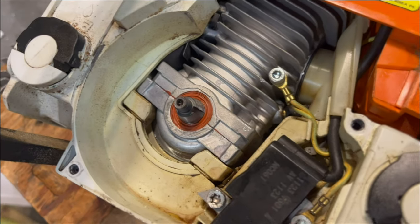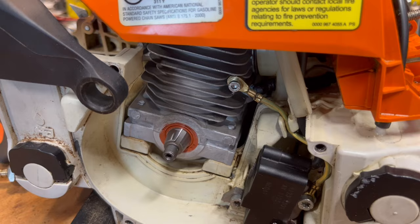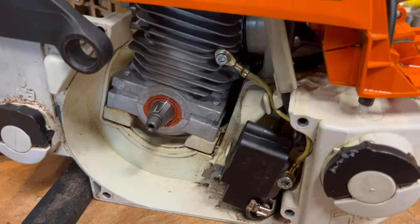So we found our leak during pressure testing, and we can stop here. But I just wanted to show you that you slide it like this, and now you have a vacuum tester. So at this point, we either have a leaky motor that we need to reseal, or a blown motor that we need to replace. Either way, that's got to come out.